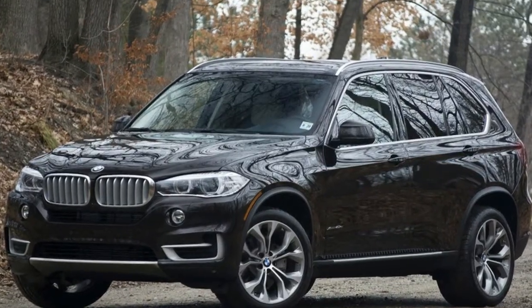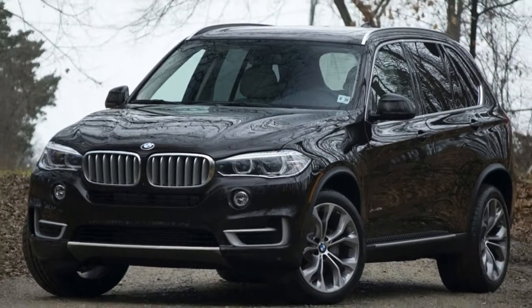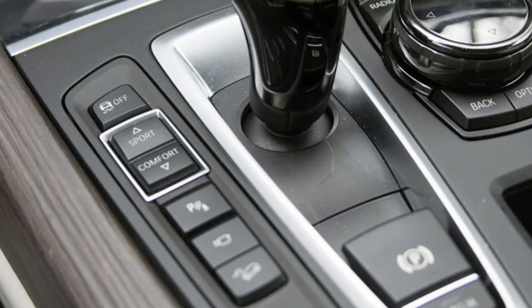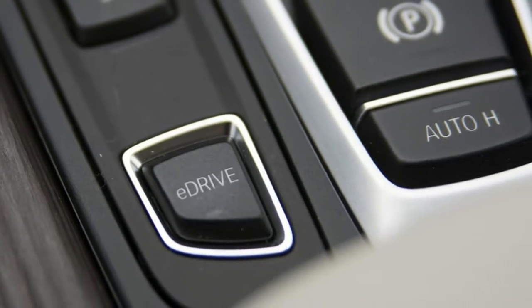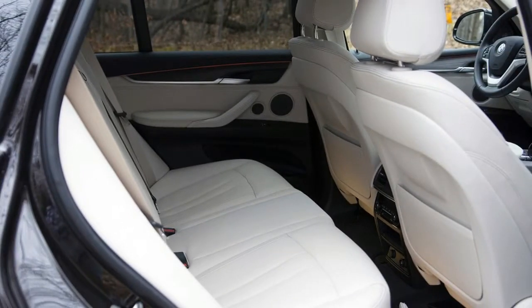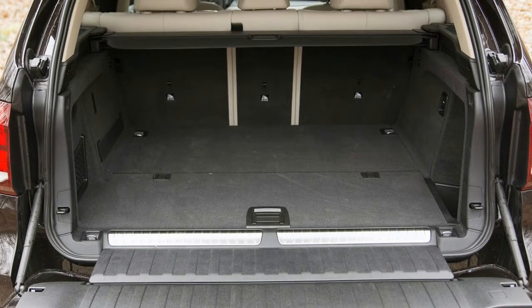Sport mode's aggressive energy recovery is the fastest way to recharge the battery on the go. When it's working, there's a sensation similar to gently stepping on the brakes, though you actually aren't doing anything. This is a familiar experience to the way most EVs use regenerative braking. Comfort mode reduces this effect and, in turn, how much energy is recaptured. And contrary to what you might think, EcoPro further reduces the regen, but limits the electrical draw from the HVAC and other systems.